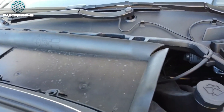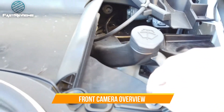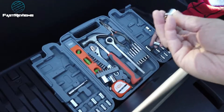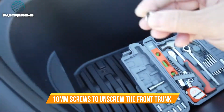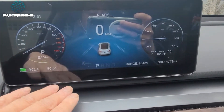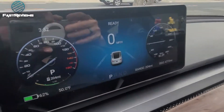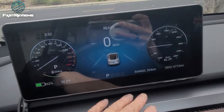Now we're going to proceed with installing the front camera. There's a screw right here that people miss — this whole assembly is going to have to come up. You can disconnect the battery if you want. Right now we're finding out which bits fit into this category — this is European millimeters, that's inches American. 10 millimeters is the standard they're using, and that's going to give you access to all the bolts here. The battery is connected right here if you want to take it. This is my installation — I still have access to the vents. You simply have to cut the tabs off in the back. If you don't do it this way, there's a vent cover you can use so the screen doesn't get hot.